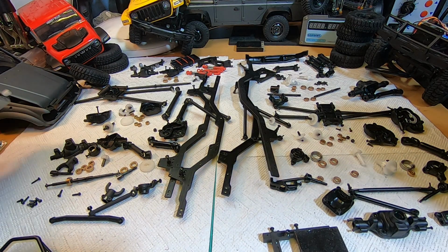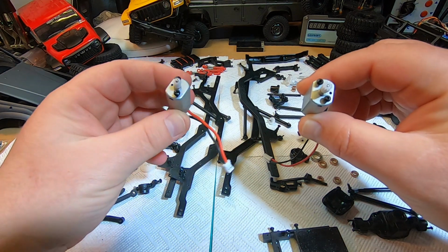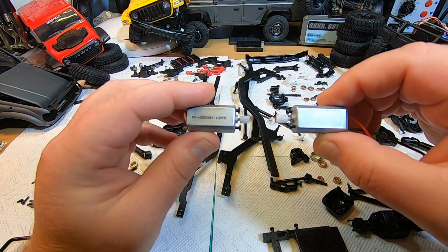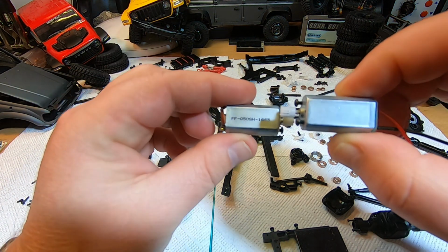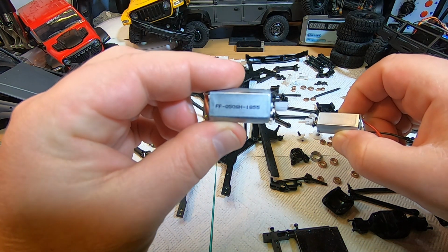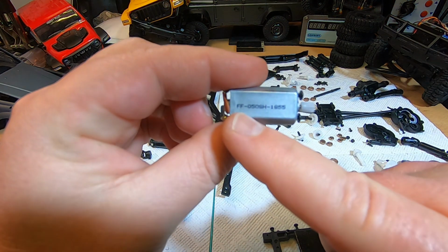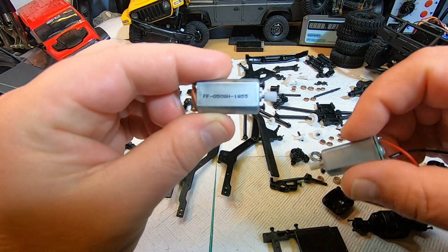Let's start with the motors. That's the motor of the EazyRC Patrion, and that's the motor of the CR-18, and the RocHobby Katana does have exactly the same. You see the motor is of the same size, but it's not the same motor. Those CR-18 motors and Katana Atlas 6x6 are the so-called barrage motors. Also the small RGT motors of the 1/24th, those motors do all have exactly the same lettering on the can. So probably they are the same motors.